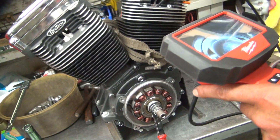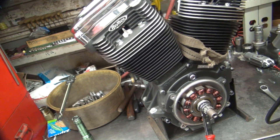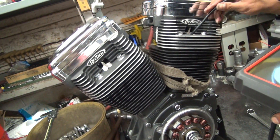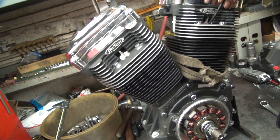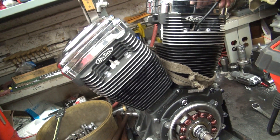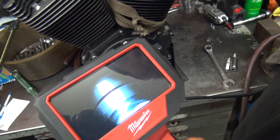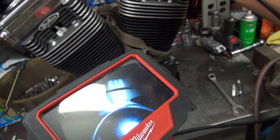CCI - yeah that's a dish. That's a nice piston. It's got a four and a half kit in it, so it's going to be four and a half by four, which is a 113 motor - even though they made it as a 110, not a 113. A four by four is a hundred inch motor, which they also make. If it's four and a half by four, that's a 113 as I recall. We'll calculate it in a minute.